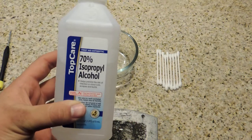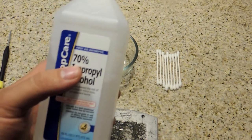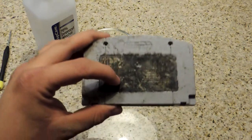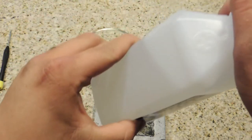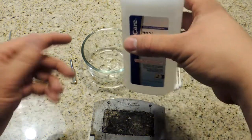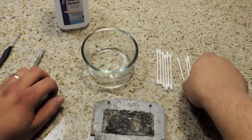You'll need cotton swabs along with some isopropyl alcohol. You can use any percentage you want — the higher the percentage, the more harsh and potent it is, which isn't a bad thing for cleaning. However, to be sensitive to the label we're working on, I'm going to try and salvage as much as I can. So I'm going to go with 70% isopropyl alcohol to make it a little less harsh. Let me pour that into my little container. I also like to let the screws soak in it, because if there's any built-up grime, it'll help clean them up a little bit.